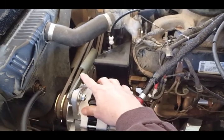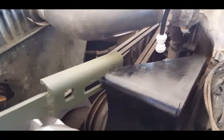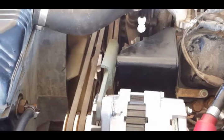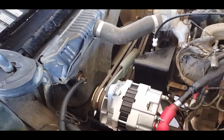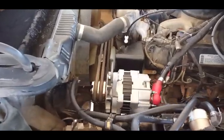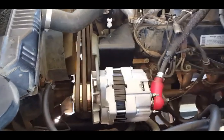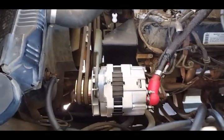Instead of cutting the bracket, you could probably go with two shorter belts. To get those belts off there's a hydraulic hose going to the clutch fan that you have to remove, and then there's a belt to slip over the fan. I thought extending my bracket was a little easier — I like welding. Getting that hose off is apparently a nightmare; people are taking radiators and hoods off just to deal with it. Or if you wanted to mock it up with the original pulley, you'd just have to cut more off the main bracket and recess the alternator back a bit more.